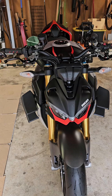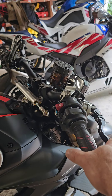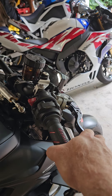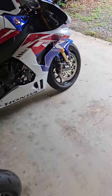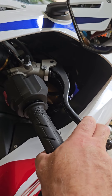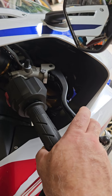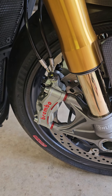Eventually I'll probably flush this for some Motul high-temp brake fluid, but for now we'll just use regular DOT 5.1 — I think the wet boiling point on that is 375°F. The brakes work great, it's just the first bite has way too much take-up. Even when they're pumped up, that's too much. Compare over here on the Fireblade — this has the same master and caliper setup, and that's what it should feel like: super positive, feels identical every time. These brakes never fade no matter how hot I get them. Since the setup is identical, we're going to go ahead and bleed these out once I get the right fluid.